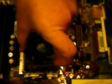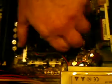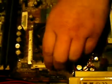which is why many people, so I fit the edge over here on. You don't want to be pushing and pulling and all that too hard. And then you're going to try and fit it over. And it's not on. That's why you gently pull to see if it's on. Push and see if it's on. And it's on. Now I'm going to gently try and push this right back down on. And if it doesn't go, don't just keep shoving because you will bend the pins.